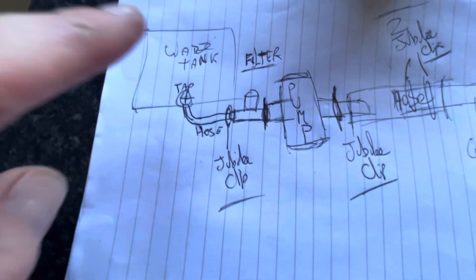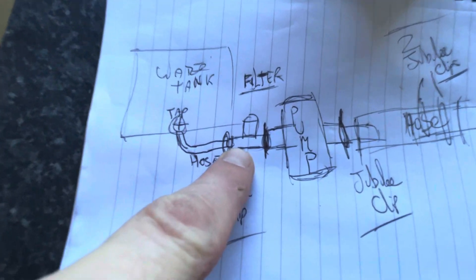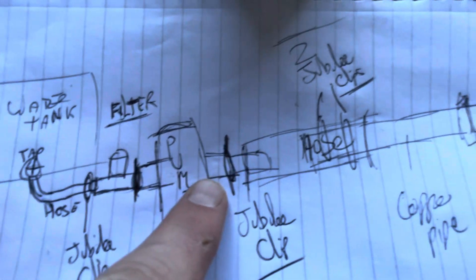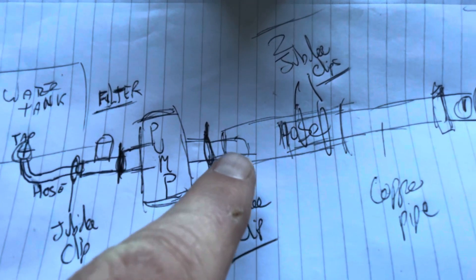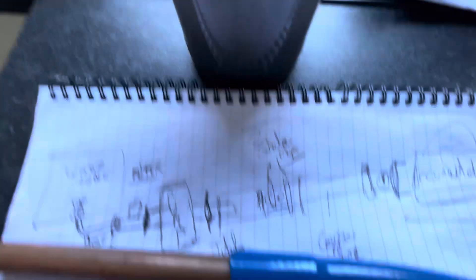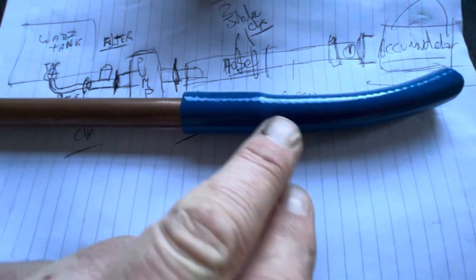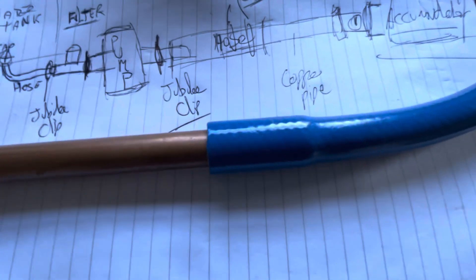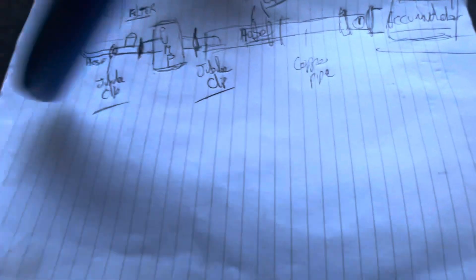So the plan is: water tank, existing hose, jubilee clip onto the filter which joins straight onto the pump, and then from the pump I'm going to attach a hose with jubilee clips. I made this - that's water quality hose, strengthened, and when I warmed it up in a mug of water I can get it on this far. As it's going to be on the pressurized side I'm going to add two jubilee clips to this. I'm going to use a longer bit of hose - this was just a mock-up to see if it all fit together.